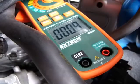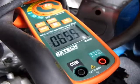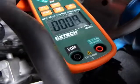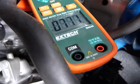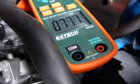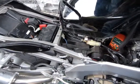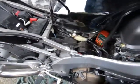Everything is just balancing on edge — let's see that measurement again. Sorry, didn't set it to maximum. Okay, one last time. Alright, 77 amps. So that's why when you try to check your battery and check voltage, if you connect the voltmeter wrong — don't try to measure amps with any ammeter other than a clamp-on. It can take huge ampere loads; this one is over 70, like 77 amps, so you have to use a clamp-on ammeter.